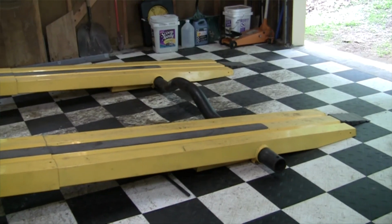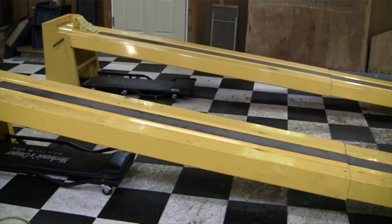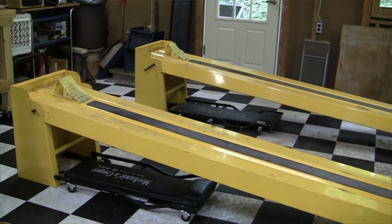There are many more steps to lift a car using a QuickJack, and there are many more points of failure. That said, the QuickJack is ideal for working on wheels, such as doing a brake job or replacing a tie rod or shock absorbers. The QuickJack is also more portable and easier to get out of the way. A QuickLift is so bulky that I never moved it and I just parked a car on it, which is not something that everyone is willing to do.